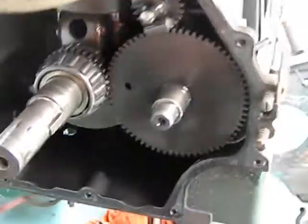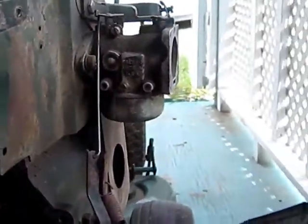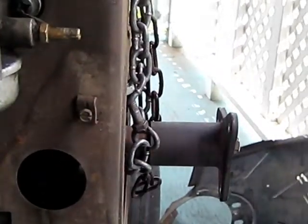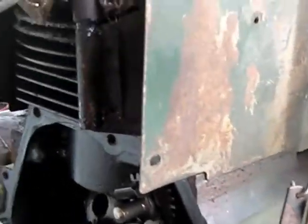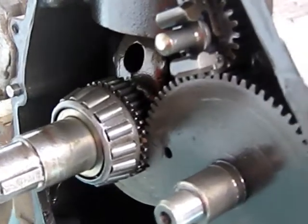If it don't work this time, I don't know what I'll do with it. I like these old mowers — they're very stout — but it's got a Tecumseh engine, and typically I don't like Tecumseh, they're usually a pain. But these big ones are cast-iron heavy-duty things. I've really never had any problem until this last month. So in case you ever wonder why they're spitting gas out the carburetor, and it ain't an intake valve or something way out of adjustment, maybe somebody has pulled off the side cover and put the timing back wrong.